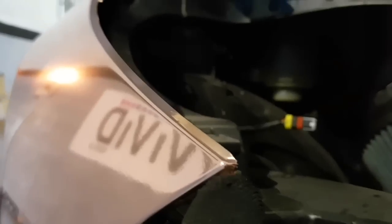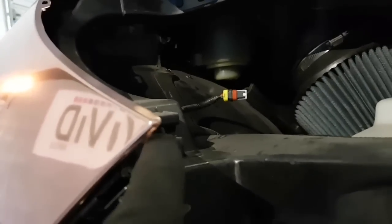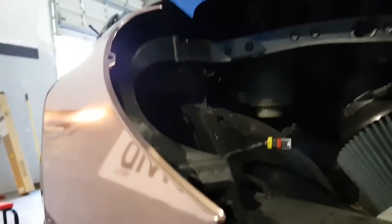And then it is a little bit wrinkly on the underside here, but again, I didn't really use any heat, right? So I just fixed it, but usually wrinkles like that would be due to excess film, or you just didn't go over it thoroughly enough. You would never see that because that little bit of wrinkle will be behind the headlight and the bumper. These seams meet very tight. Sometimes they're too tight where they actually cause issues between rubbing, so you've got to be wary of that. But that's generally what your corners should look like and how you would do them when using chrome.